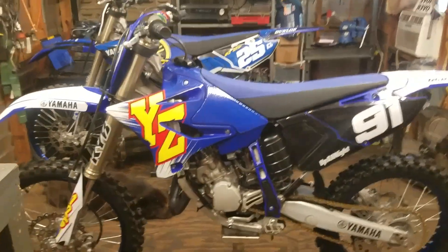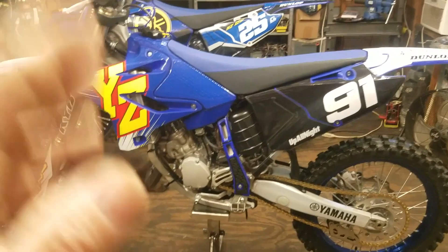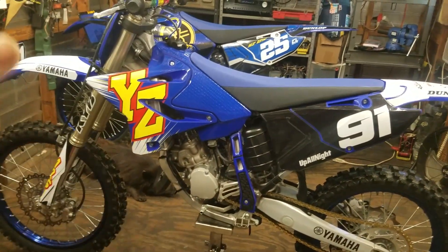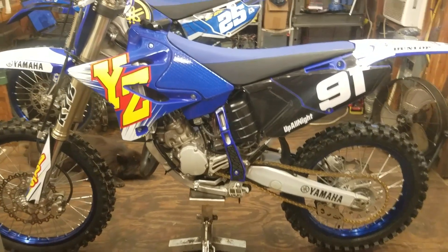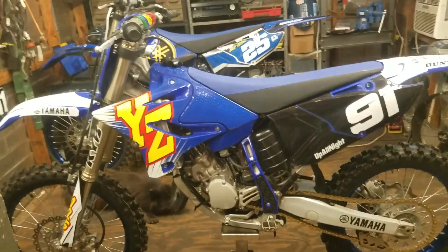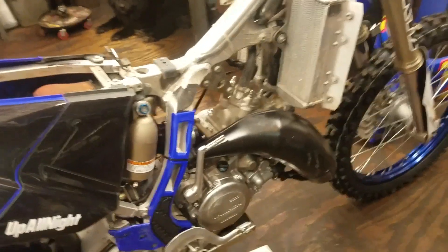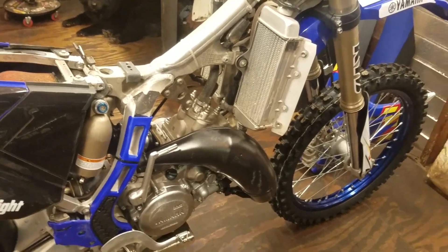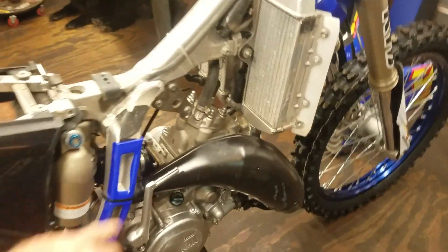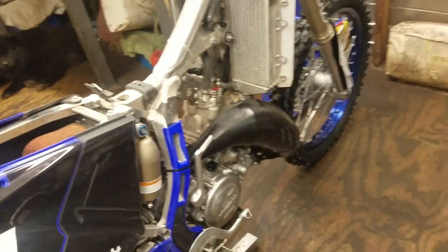When I'm done with this, I'm going to take it to the track, test it out, tune it in — that'll be at the end of the video. Stay tuned or fast forward if you just want to see the ride. Let's get the seat and tank off and get started. I got that off. Now I'm going to go ahead and drain the coolant, remove the motor mounts, the hose, spark plug, and all that. Then we can pull the head off.